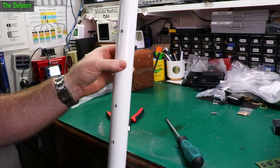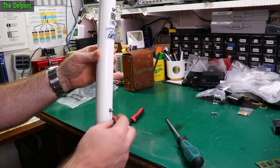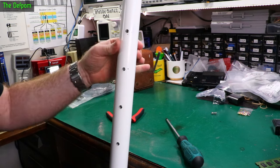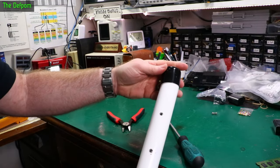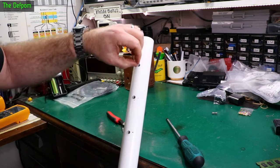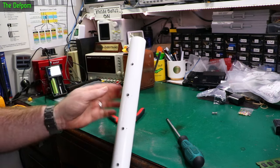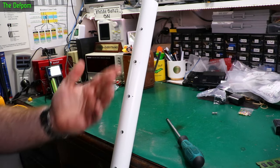The trick to get these poles out is you have to take all the screws out the back. I've still got this top one fully in — I've already loosened the other ones. To actually slide the circuit board out, which you slide out the top, you take the little rubber cap at the top — the black rubber cap — and pull it off. Then you have to lift all of these lenses out. You don't have to take them fully out, just lift them enough so they're not touching the circuit board anymore — you've got to clear the LEDs inside.